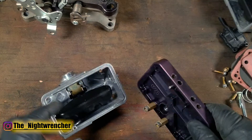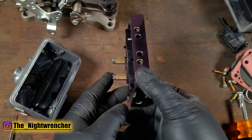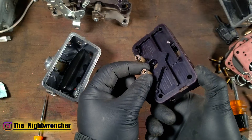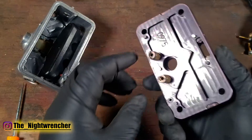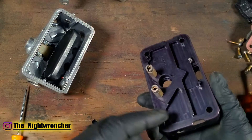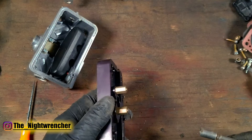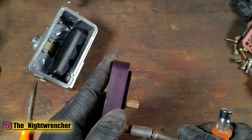Typically you want the notches in the rear; you can use them in the front but it's not really necessary. The extensions are for situations like a wheelie or a hard launch — the carburetor lifts up, all the fuel goes to the back. The extensions act like a straw and keep the jet submerged in fuel so you don't run lean on the secondary side. It's more of a high-horsepower hot rod thing; you don't really need them on a street car, but the race series carburetors come with them factory installed.